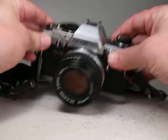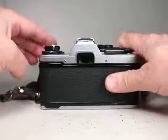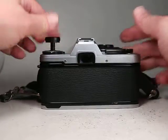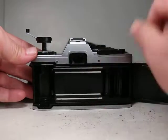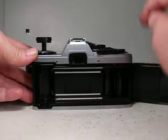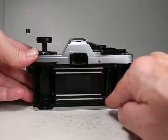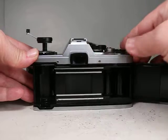At that point now I'm just going to turn the camera back on, and we're going to look around the back. And we open the back by pulling up on the film rewind crank. Back pops open like that. We see it's got a cloth focal plane shutter. And we're going to watch this and the film advance as I run the film advance. We saw the curtain go across, and we saw the film advance work. We'll do that one more time.